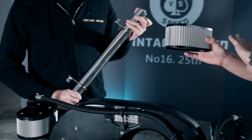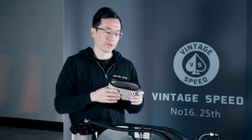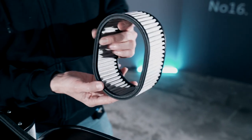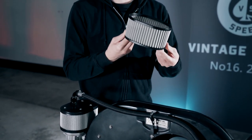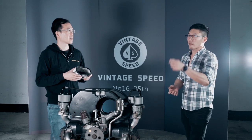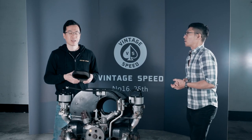Would you like to explain the special features of our air filter? We've been working on this for a while. The upgrade is that it's all stainless steel, which means there's no chance of catching a backfire from carburetor popping. We also made the filter thickness a little bit smaller than a regular K&N, giving you more airflow around the stacks for better performance. This filter can replace all the filters on the market — the overall ones for the IDF and the DRLA. For the IDAs, we're still currently developing those, so yes, we are working on them.